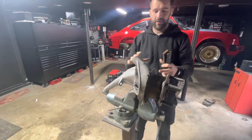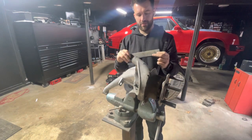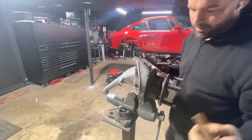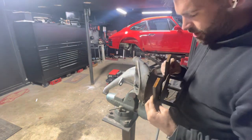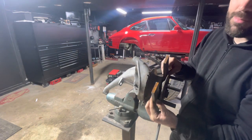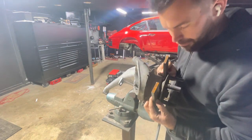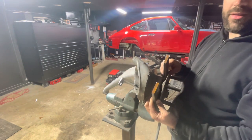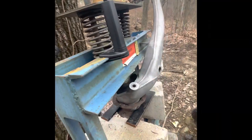One way I was able to get it is using the regular wheel bearing press assembly with the pump jack. To get a flat surface I used two three-eighths-inch thick pieces of steel — I bent them a little pulling the one, but it did work. You just slide them right in between here; you may even be able to use a half-inch thick piece. It's a little sketchy because there's not much meat on there, but it did work.